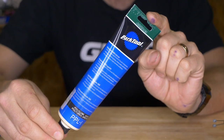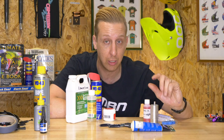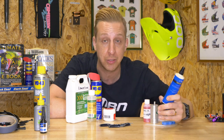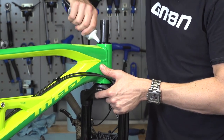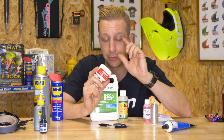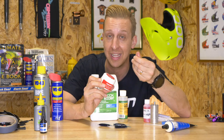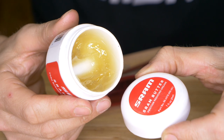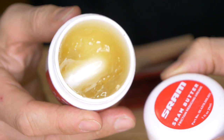An all-purpose grease is really handy. We often refer to carbon gripper compounds and assembly compounds, but most important is an all-purpose grease you can use on bearings, pedal threads, your headset, and a whole number of things. This particular one is carbon-safe so I can use it on virtually any bike in any location. For the seals in a shock and fork you'll need a dedicated suspension grease that's not harmful to rubber and is thin enough for that purpose — this one is by SRAM, but there are lots of options. You don't need to use much, and one tube will do several services.